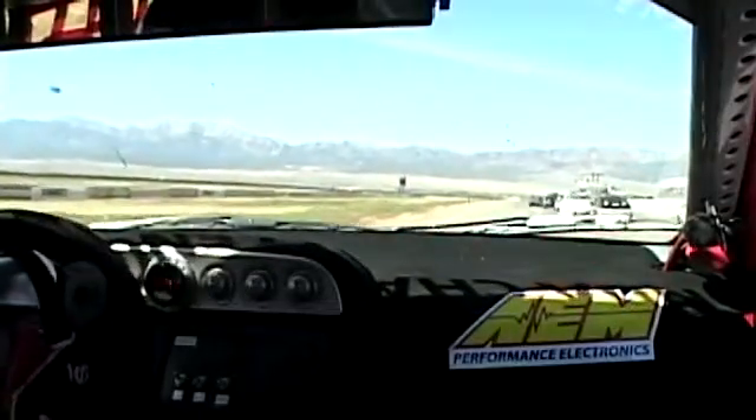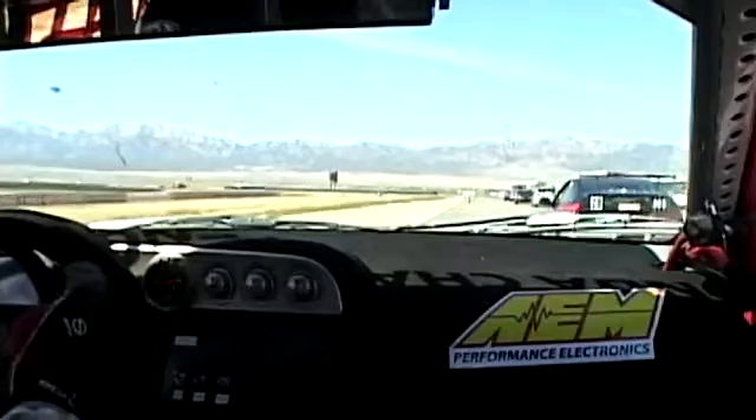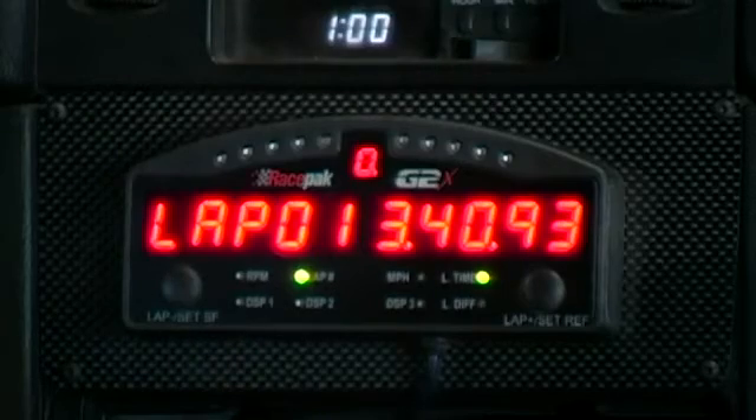Run the X-Wi-Fi in a race car and instead of monitoring your air fuel on your iPhone, you can data log to an EMS, an FIC, an AIM dash, a race pack, or anything that can take a 0-5 volt input.